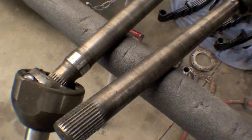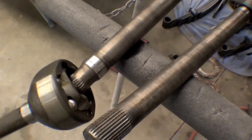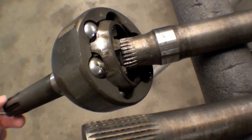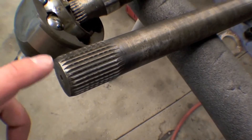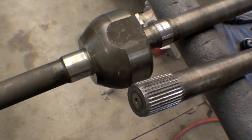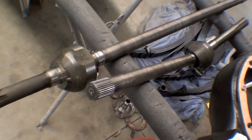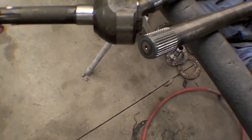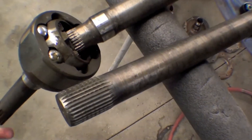This birfield has a ball bearing type joint with a fine spline in there, as well as on the ends. Later model years are coarser splines — this is called fine spline. This is what the drive shafts look like when they go in: one short, one long. This is towards the outside where the hub is locked in and out, and this is what allows the wheel to turn. It's a really pretty joint.